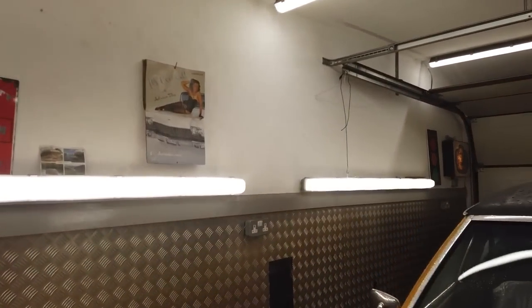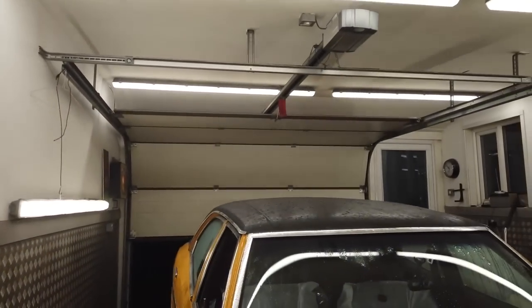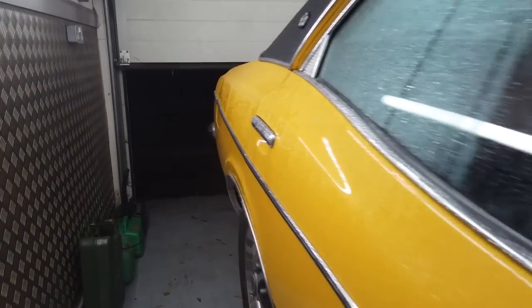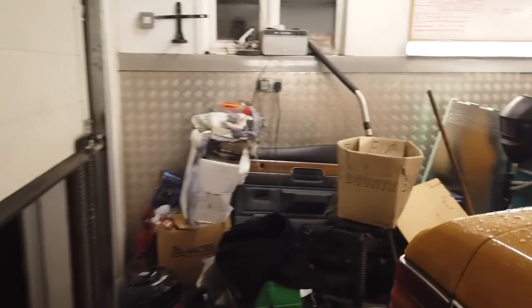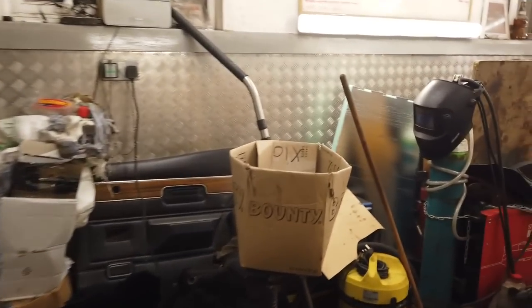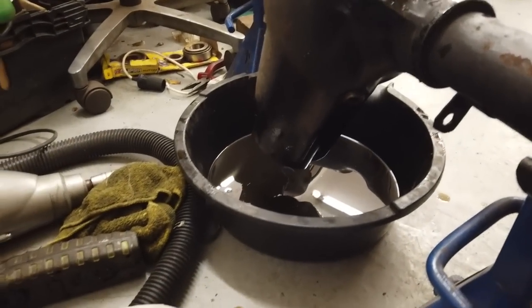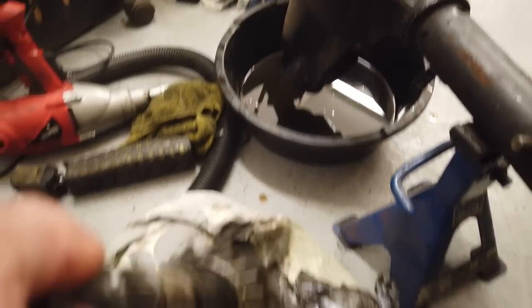but what we didn't count on was the axle going to be faulty. You know, you just wouldn't expect this. We did worry about it because it seemed stiff when we were placing in the prop shaft and rotating the prop shaft for the four prop shaft flange bolts. It seemed stiff then, and the stiffness was probably, what do you think to this, Rich? The stiffness was probably a couple of rollers seized on this.